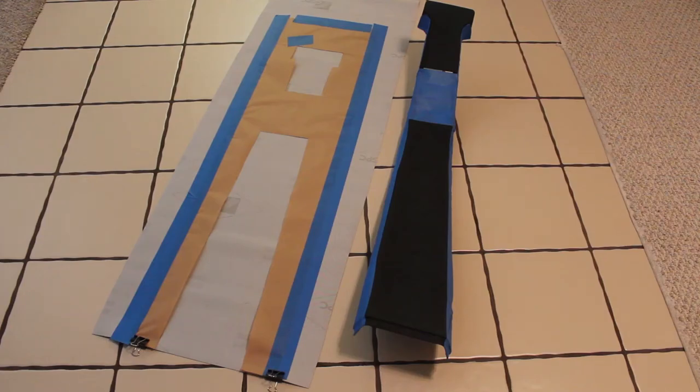I'm almost ready to start gluing the material down. I've prepared the old B pillar — pulled off the old vinyl and removed all the glue, which took a few hours. I've taped the sides because I'm going to glue the top part first. I'll put down some masking material underneath and use the spray adhesive. I also made a template for the vinyl so I only get glue on the parts that will actually be stuck down. That way I can work with the material more easily without it getting stuck somewhere prematurely.